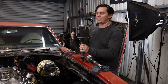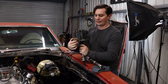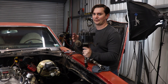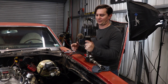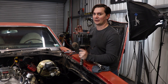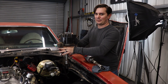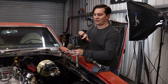Odds are a lot of guys are using something like this — something much bigger, obviously. You need to be able to run a vacuum line here and plug it in here. I usually put this on this side, kind of facing the passenger side. I usually just find better luck with that as far as fitment, and there's usually enough room with the wires back and forth. Something like this is going to limit which one of these can be your number one, so eyeball it, put it where you want, make sure you can go back and forth with it, and then pick one to be number one.